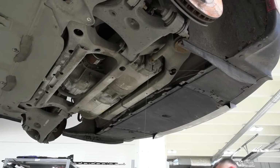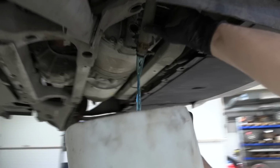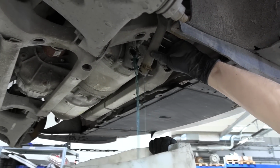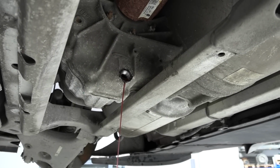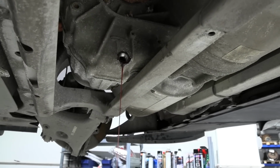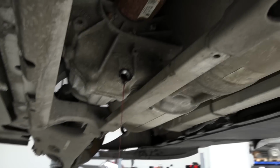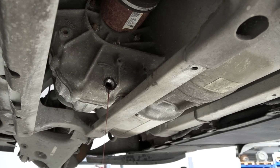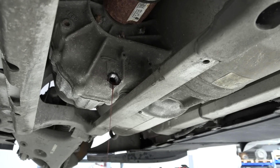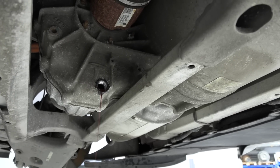Yes. Okay, so we empty out this coolant, drive unit coolant. Oh, look at that. First time I see it, at least. All right, so you see, that's the coolant, and here we have the drive unit oil. See, this has a different color. It seems to be reddish. So despite what people think, Tesla doesn't need oil changes. Well, actually, from what I heard, the oil change interval is 8 years or 240,000 kilometers. So if you can get a free oil change in a Tesla, you can just go for it.